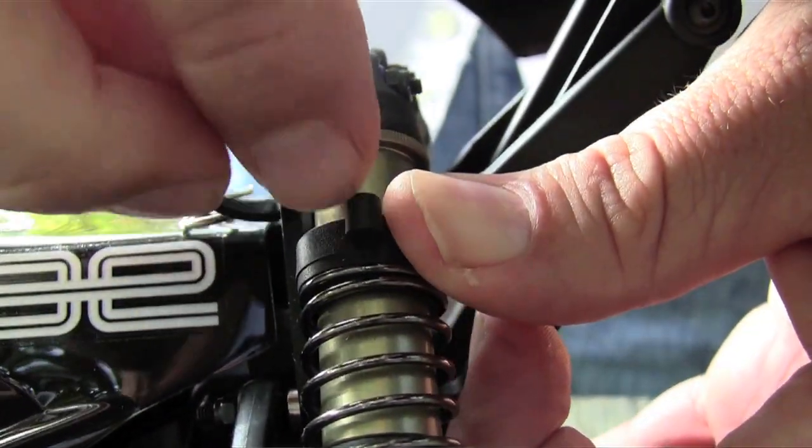If you don't happen to have the gauge, you can still use the same flat surface you started off with. Have all the gear inside the car, compress the suspension a few times, sight the car from front to back. You want to check to see if your dog bones in the rear are level and your camber links up front are level as well. That will be the best way to check your ride height.